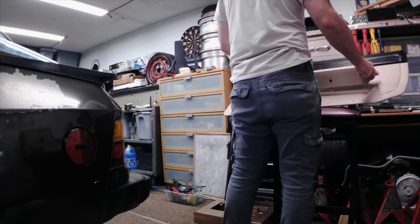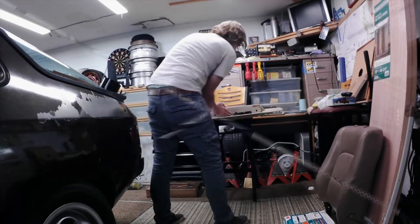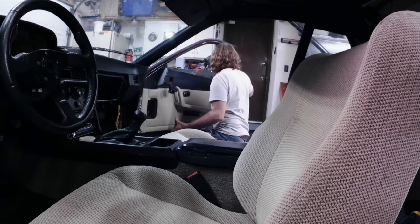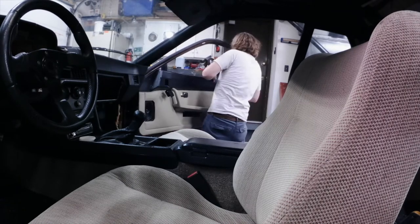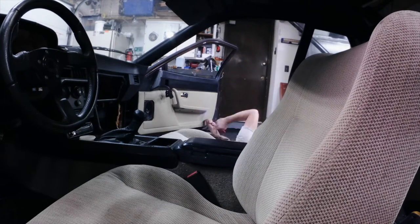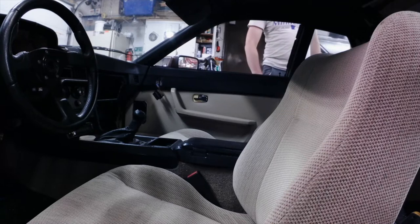I had to reassemble the door panels. Here you can see I put the door handle on, then put the piece that holds it into the door on the back side and tighten it down with a wrench. Here I'm starting to put on the passenger side panel — you want to tuck the wires through if you have power windows. Watch your lock rod because you'll catch the door panel on it and bend it. Get your body clips in the right holes, and first and foremost get the piece bolted to the back of the handle to tuck into its pocket on the door, then lower the door panel down over the body clip holes.